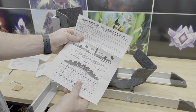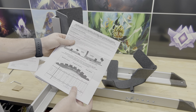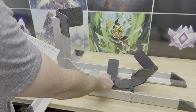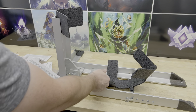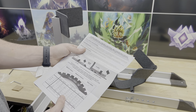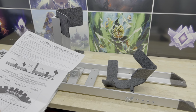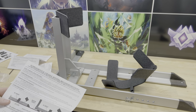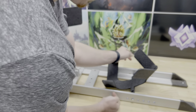For our rim size and tire width, we can set which position this should be in. An important thing to note: the optimum setting for a specific tire is any setting that allows the cradle to tilt as far forward without making contact with the surface below it. Whenever we load the bike up, we'll check for that, and if it's too close we'll need to switch settings. Mine is a 17-inch rim with a 120-width tire, so position three, four, or five — pretty big range.